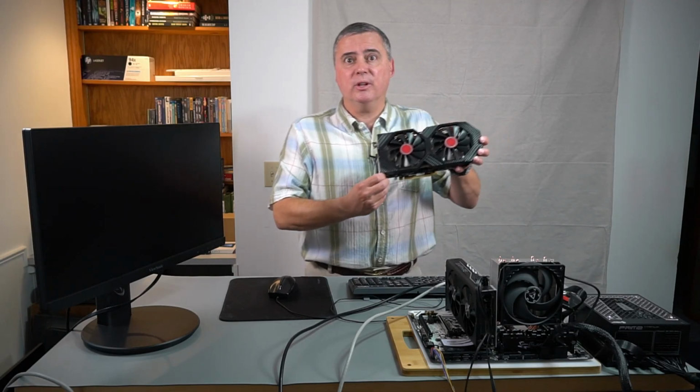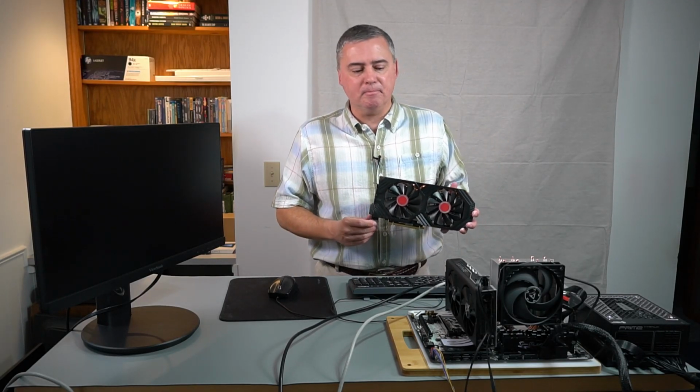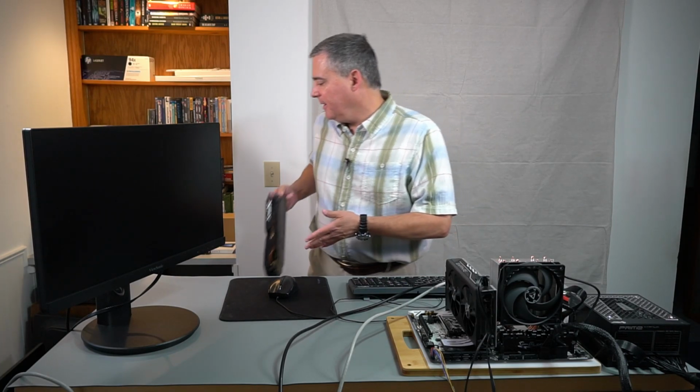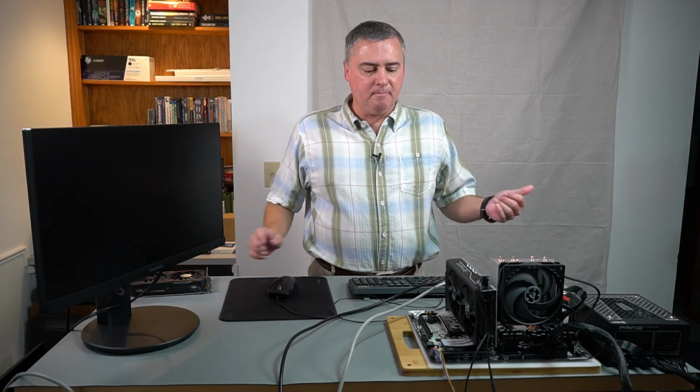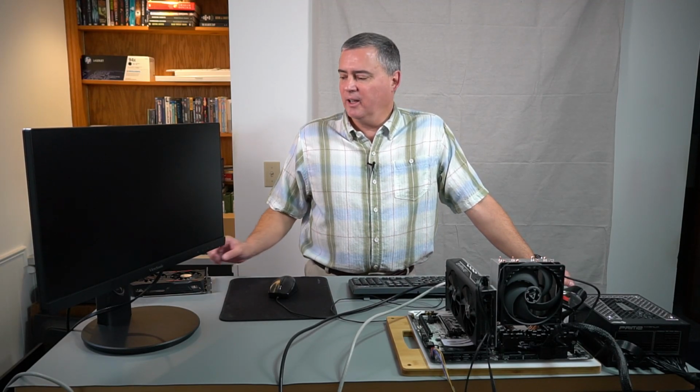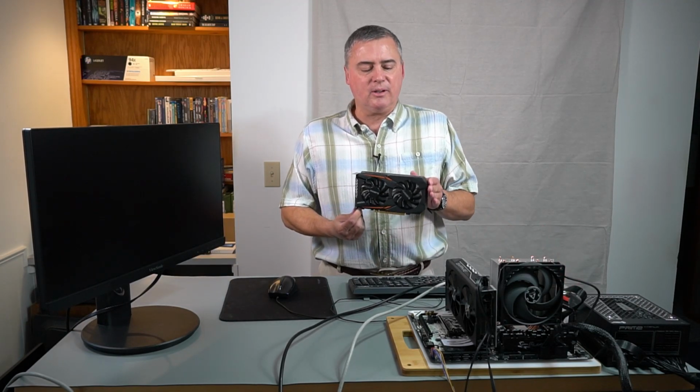Now, how did I troubleshoot it? I didn't record that, so let me just explain. So the screen was bad. I tried several different cables. Just in case a cable was bad, I disconnected the screen recorder. I tried a DisplayPort cable. I tried another HDMI cable. The graphics card displays the same thing no matter what kind of cable is used, so it's clearly the graphics card that's bad. So then I picked up an old graphics card that I had laying around.